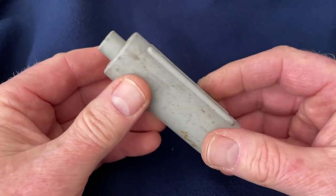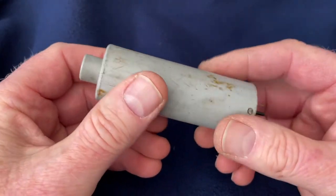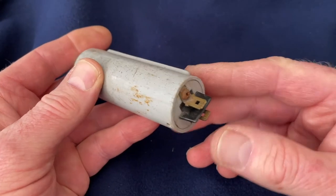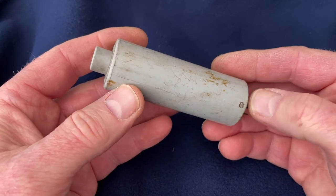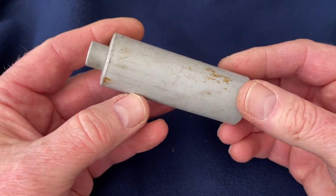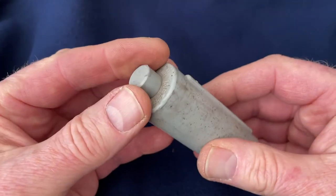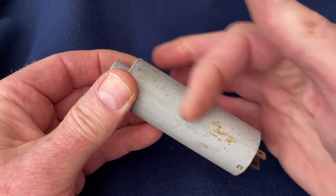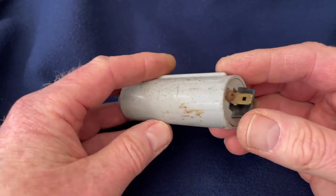There are a couple of terminals here. For the sake of Harry's Stag, I'm going to see if I can break into this a bit more and break it down to its component parts to show you what makes it tick. Then you can make your own decisions as to whether you want to use yours, refurbish it — which I know one or two people do — or opt for a more modern 2022 version, which online seems to be about 50 or 60 quid. That's the principle: a simple switch that cuts off your fuel when actuated by the ball bearing flying about inside on a rollover, fast deceleration, or crash.